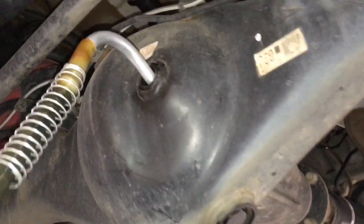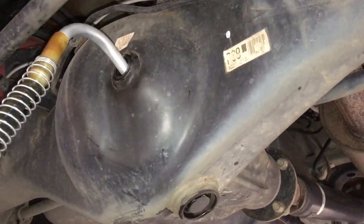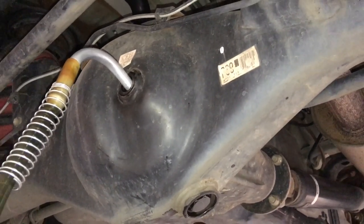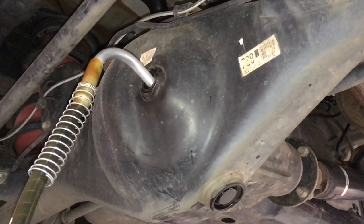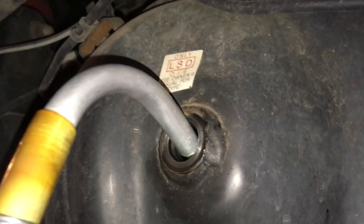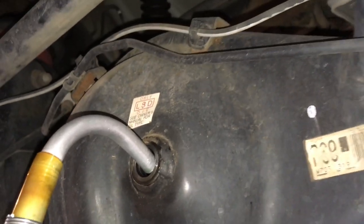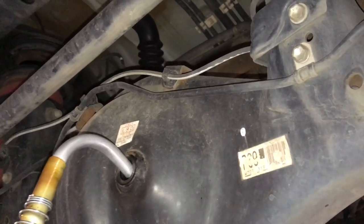It's always wise to have a larger drum, like a 20-litre drum at least, with a pump. What you can do is have a setup like this rather than trying to squeeze in those silly little bottles - they create a lot of extra work. A 20-litre drum and a pump is going to help you get that done. When it starts overflowing at the filler hole, stop pumping and let the excess flow out.